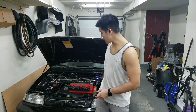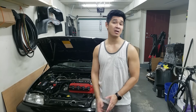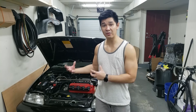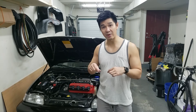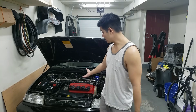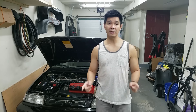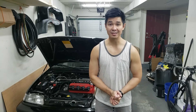We're fully converted to coil-on-plug now - everything is installed and working fine. It looks fantastic in the engine bay, giving it that modern touch - looks like a performance engine even though it's completely stock. The biggest trouble during the whole install was the billet aluminum distributor cap, which took forever to modify because the bolt holes weren't cut perfectly - I had to modify the holes to thread in the bolts, and did nick it up a bit. Overall everything is working fine while idling. This is the BTO Best Tuning Option COP kit - I hope this install helps you guys out. Please like, comment, subscribe, and share. See you in the next one!